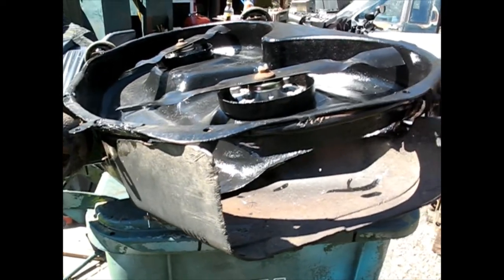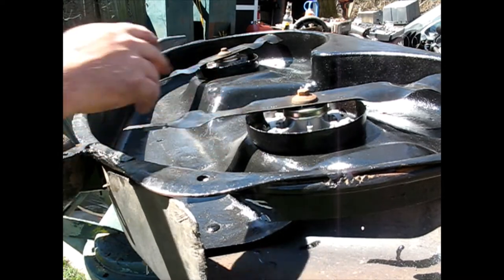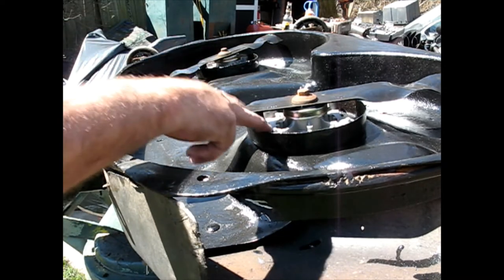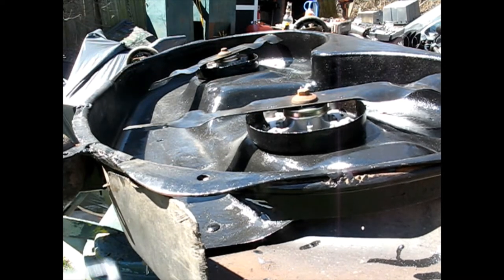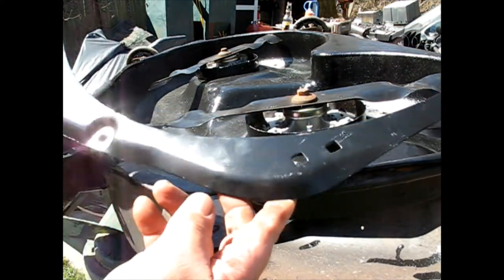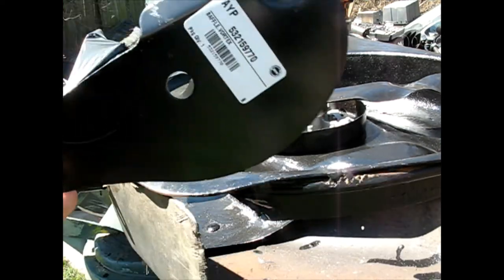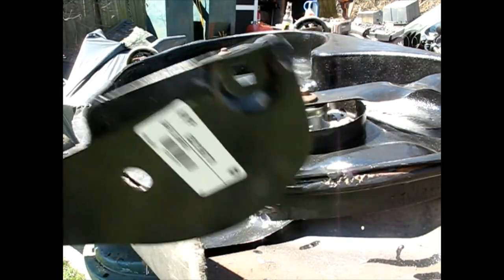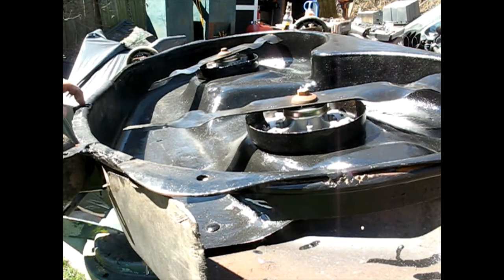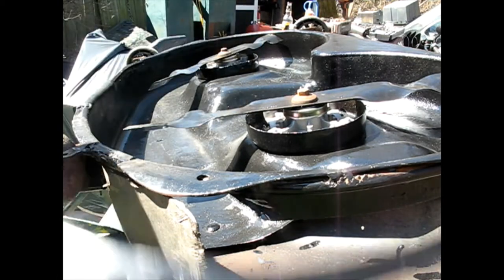Now the last thing I want to do, the last part I got, so we got the new spindles in, sheaves, some people call those mandrels, I don't know why, they're spindles. The last piece I got is this, which I didn't realize even belonged on the deck, but I was able to, it's called a baffle, vortex. So the screw hole that I had previously welded shut actually was for a carriage bolt.